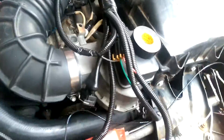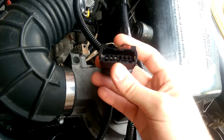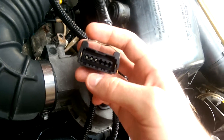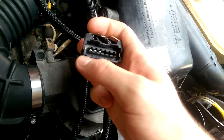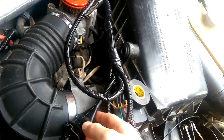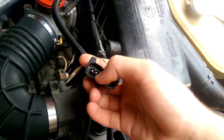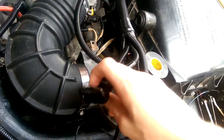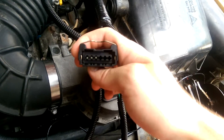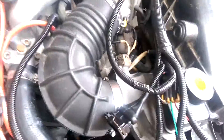I wanted to mention something I had to do a little homework to figure out. This is the six-pin connector for the 951 TPS. The pins are: plus five volts — it has its own five-volt wire for the TPS, and you tap the MAP sensor's five volts from it. Then you use a signal ground, which goes into the ground splice. And lastly, the third pin is the TPS signal wire. Those are just the first three pins — the connector even has them labeled one through six on the TPS.